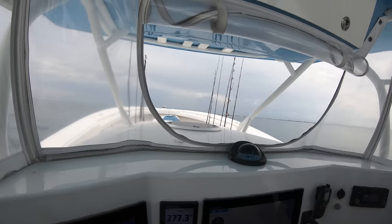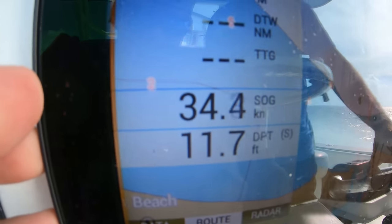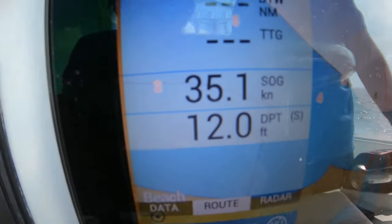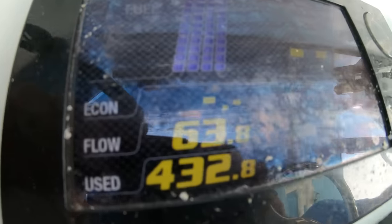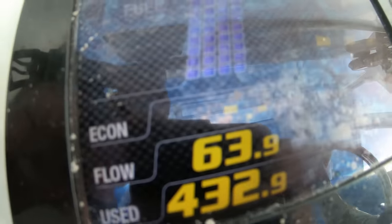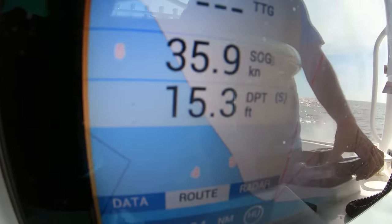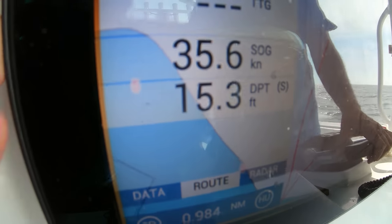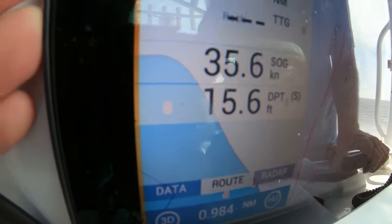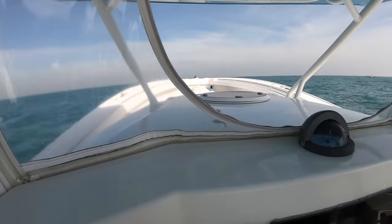But it was really the cruising speeds that showed the difference, because with the quads, we were cruising at around 40 miles an hour running 43 to 4400 RPM, burning about 50 gallons per hour. Whereas with the trips, we were doing about 40 miles an hour running around 5000 RPM, burning about 62 gallons per hour — which is a pretty massive difference, with about 10 to 12 gallons less and about 5 to 700 RPM less. With the right props and trimming, you could probably push those numbers even farther apart, maybe 41 to 4200 RPM and mid 40s on the fuel burn. So we're talking around a 15 gallon per hour difference in fuel burn when cruising, and I think that is probably the biggest comparison point anyone could bring up.